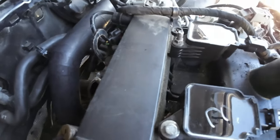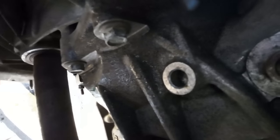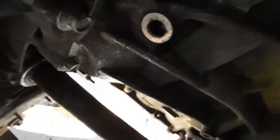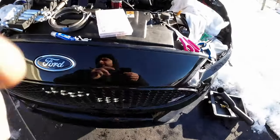So now, the last thing I want to do is get a size for my coolant plug, which is down here. Let's see if I can get you guys an angle. That silver bolt, yeah. That's what I gotta tap into, and I believe jump into that right there. So from there to there. Short, but I wanna do an AN fitting possibly. They're a little bit more reliable.